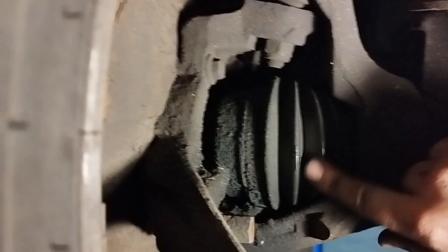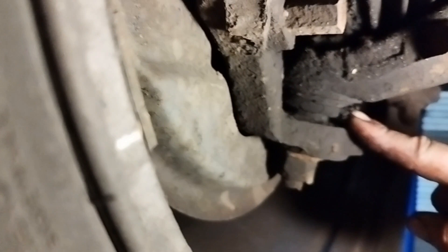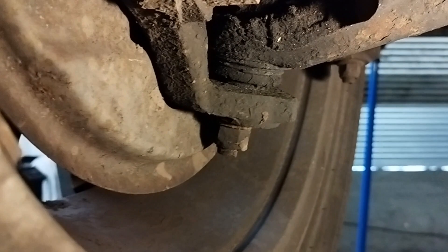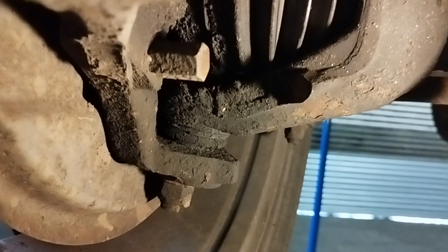Check your CV boots. You can't check them all unless it's in the air, but this is the big one — the swivel seal boots on the front. You can see these have gone on this one. They're a bit of a nightmare to change. Cars will fail their MOT on that, and when people realise the cost of it, the car gets scrapped. We've bought a few with those gone.